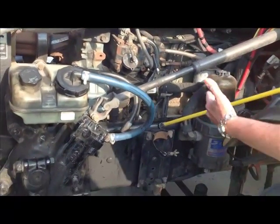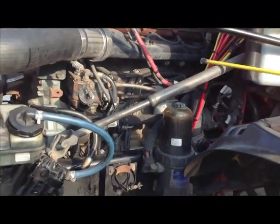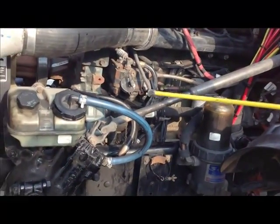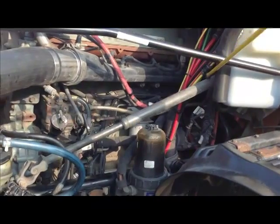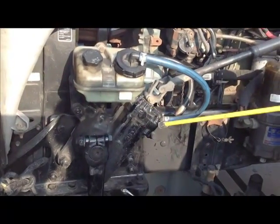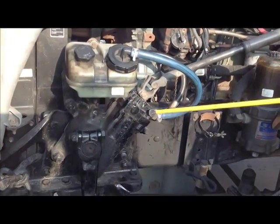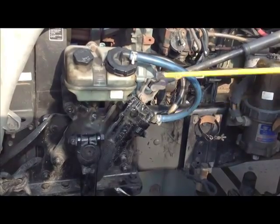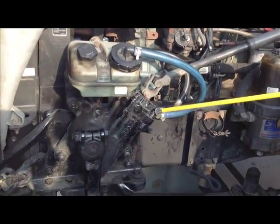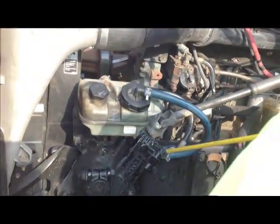Do you see how I'm working my way out? Now I'm gonna go to my steering arm or steering shaft. It's not bent, it is securely mounted. There's no missing nuts or bolts. Then it goes straight to the gearbox, steering gearbox. It looks like a box right here. Securely mounted, not cracked or broken, no missing nuts or bolts, not leaking. Anything that's got a hose into it, you must say not leaking. Okay? And that covers that part.